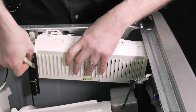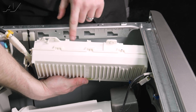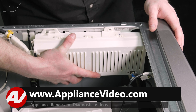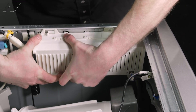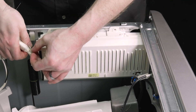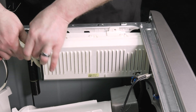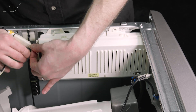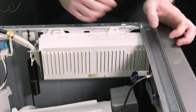Move your harness around to the side. There are holes that correspond with these tabbed anchors on the control — line it up, and then you'll have to lift it up a little bit because it has to meet in with the track. Slide it over and it should clip in place. Go ahead and tie this wiring back on. That blue strain reliever — as long as it's not damaged — pop it into place.